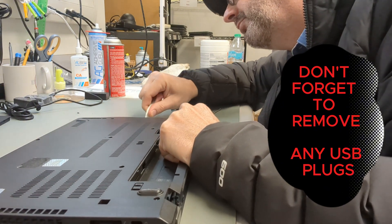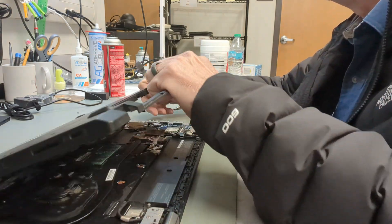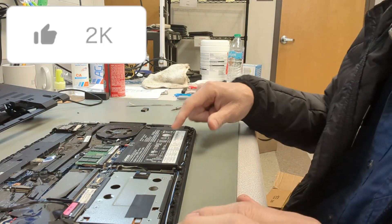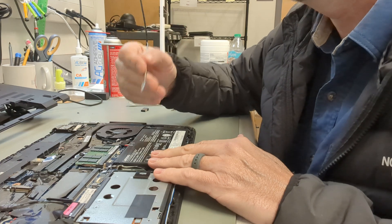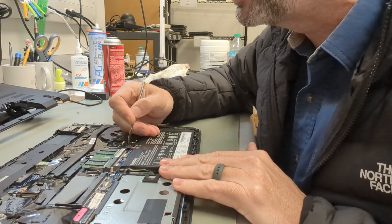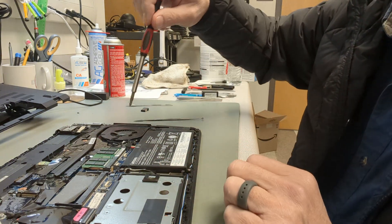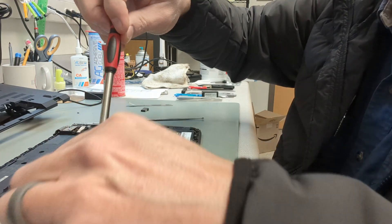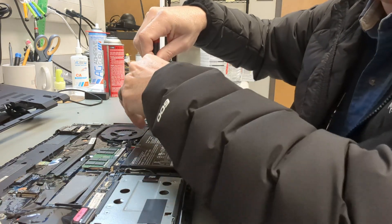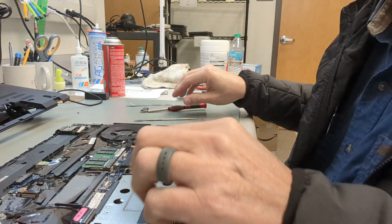Work your way around the perimeter. Also remember to remove any USB plugs — that was anchoring me — and it pops right up. Now that we're in here, you can see the battery right here. We'll take a sharp tool and on each side of the plug there's a little lip — put your tool on that and pry on each side until it slides out. This battery has five screws: bottom left corner, bottom right corner, upper right corner, upper middle, and that should free it up so the battery lifts right out.